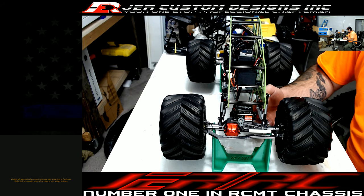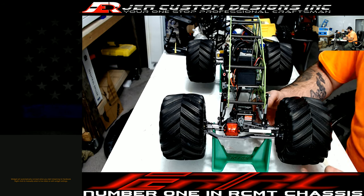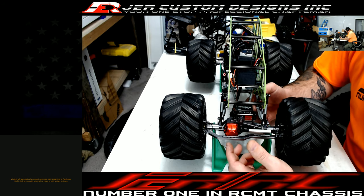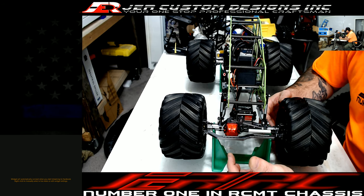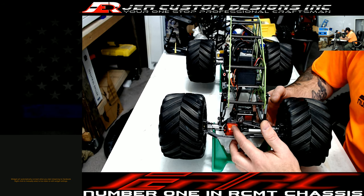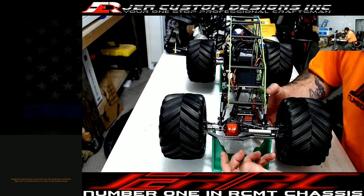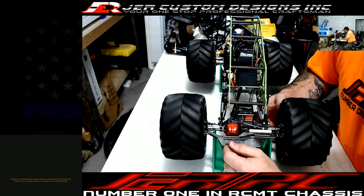They're not the best axles out there — if you want to pay $300-plus for a set of axles, that's all well and good depending on your application. But if you're just trying to have fun and bash around like I am, the only real downside is the internal gears and the diff — they come locked from the factory. You can also put any internals from a regular AR60 axle into this with the pumpkin and drive shafts — they're all interchangeable with regular AR60 parts.